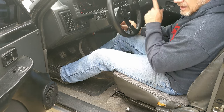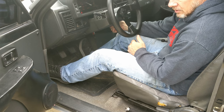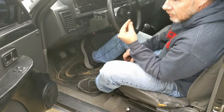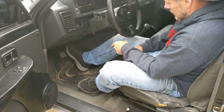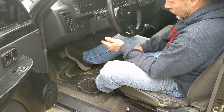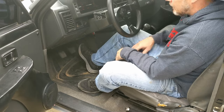It's a little cold so I'll have to check on that idle later. Let's cut it off. What we should have is soft, then medium, then hard — and that's when it's pushing out the vacuum. One, two, three, four — hard. Yeah, it's working.